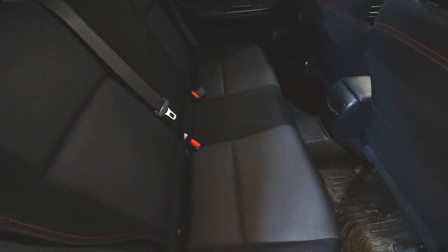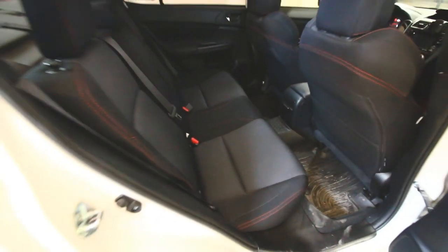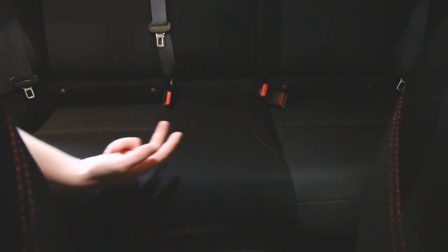But for today we're going to be doing underneath this seat, so I'm going to get started and remove that seat and then we'll get laying down some of the sound deadening material. Alright guys, so beneath each seat, kind of right in the middle, is this little clip. You have to reach your fingers underneath and pull the clip out and it will undo and then the seat can come up.